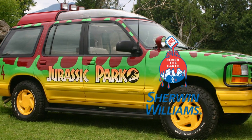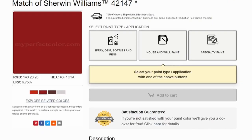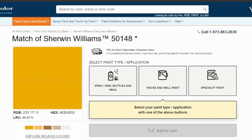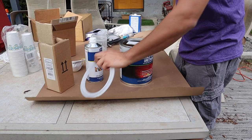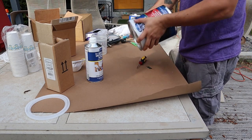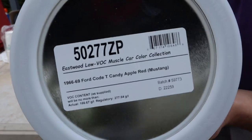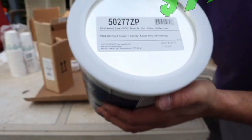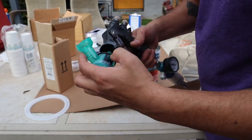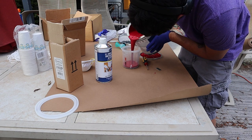Those Sherwin-Williams colors are red 42147, green 39686, and yellow 50148. Since my perfect color was on backorder and I wasn't paying $400 per gallon, I went with Eastwood to source my paint. The first paint is Ford candy apple red for $170 a gallon, mixed three to one with the activator — and that applies to all colors. I changed the nozzle to the smaller 1.3 for paint application.